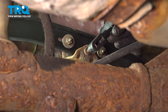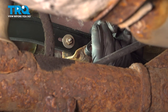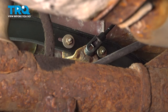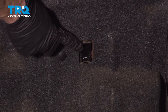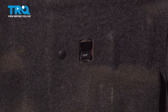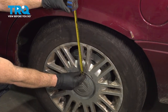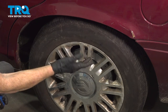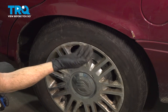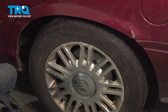Now we can take that level sensor rod and put it in position. Lock it in and make sure it's secure. Make your way out from under the vehicle and into the trunk. Put your air suspension in the on position and go ahead and shut your trunk. Make your way back over to the wheel well just to confirm that you are at the proper ride height. At this point, go ahead and take your vehicle for a road test. Let it settle in a little bit, make sure that you don't hear any funny noises, and get yourself safely down to your local alignment shop.